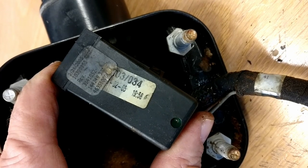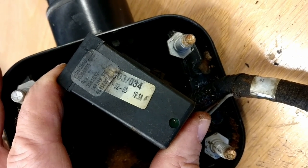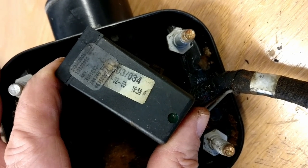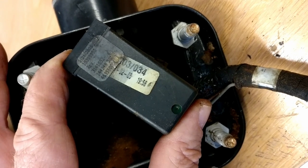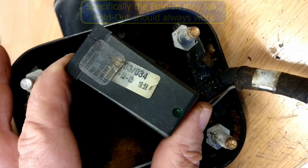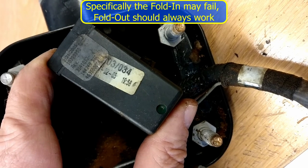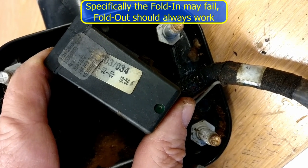It's important to keep a record, I found. How I wished I'd remembered that when I rewired the mirrors. It may not have been me that got the wiring crossed over, but as a footnote, if you cross over the wires on the mirror motors, then the feedback circuit doesn't work correctly and the power folds don't work. Something that is worth remembering. If your power folds don't work, it could be because your mirrors aren't homing and the mirrors are faulty.